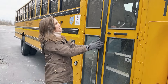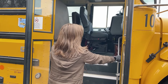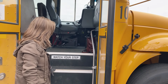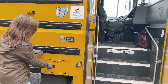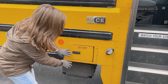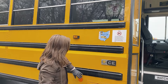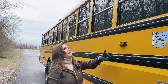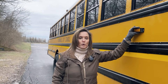I'm going to take a look at my service door. My service door is in place — glass and seal are in place, not cracked or broken, loose or missing. I'm going to take a look at my grab rails — they are bolted and mounted securely, not cracked or broken, loose or missing. My step tread is not lifted to pose a tripping hazard, not cracked or broken, loose or missing. My step lights are clear, the proper color, not cracked or broken, loose or missing. I'm going to take a look at my DEF tank — the tank, neck, and cage are all in place, bolted and mounted securely, not cracked or broken, loose or missing, and nothing's leaking. I've got my school year sticker that is up to date. I've got my reflective tape and my reflectors — amber before the duals and red after. My clearance lights are amber before the duals, red after, and my turn signals and hazards are amber, not cracked or broken, loose or missing.